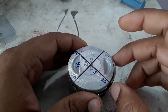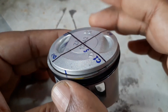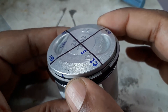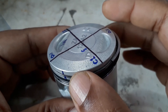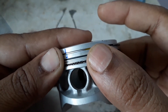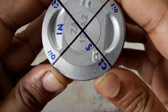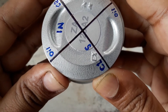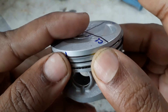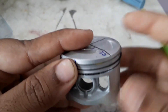All the rings are now nicely placed. After placing, you have to check all the rings — they should be free in these grooves and not tightly fitted. You can see they are free. When you press them, they should hide inside the grooves. You can see all rings are hiding inside the groove and no ring is coming outside. If a ring comes outside, it will seize during operation. This is perfect.